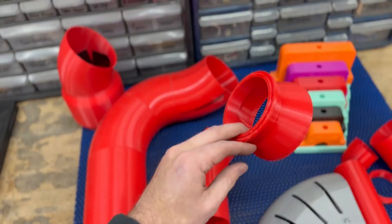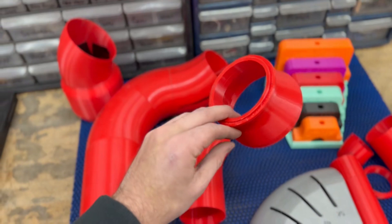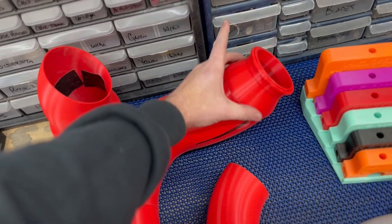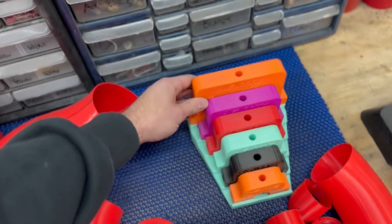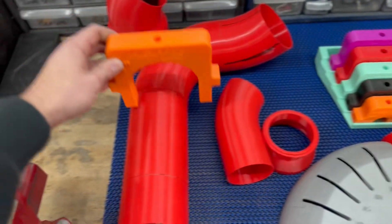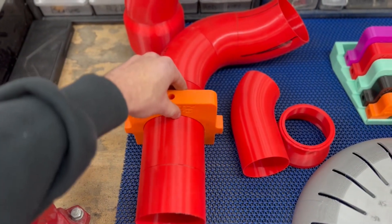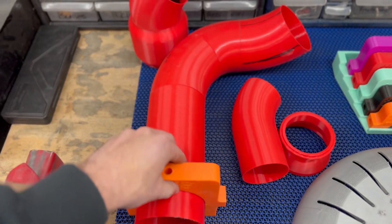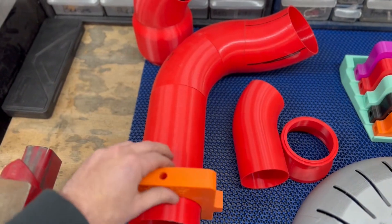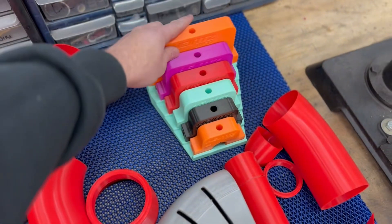So this is the start of the downpipe. I even went on to Garrett's website and got their flange dimensions so that I could make this a perfect fit onto my turbo housing and then fit up onto the downpipe. These tools here are for marking the tube in a perfect perpendicular line — I basically set this on the tube, hold it, scribe a line, and mark my three points so I can orient everything perfectly and get everything tangent the way I want it.